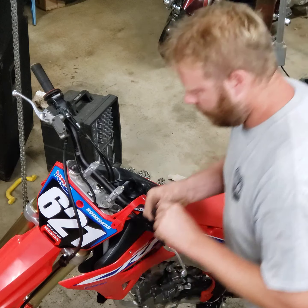Back to the install — you've got your bar clip and bushing, they go up front right next to the bar clamps. On most bikes without handlebar extensions or risers, the bottom of this clamp may interfere with the top of your fork tube. So what I usually do is lower the fork tubes maybe an eighth of an inch — just a tiny bit to get this to fit inside. Use a ten millimeter wrench; there are two bolts on each side. Just loosen it a little bit and they'll slide right down. Make sure both sides are lowered equally so you don't have more shock tension on one side.